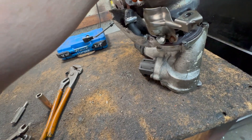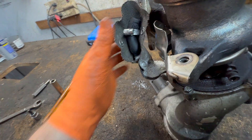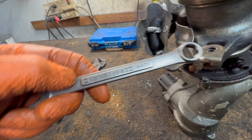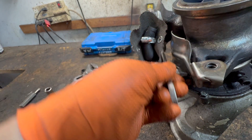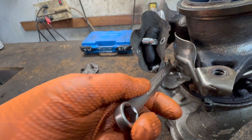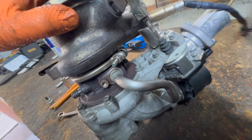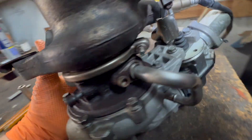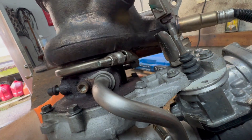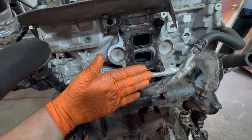Let me put it up so you can get a better idea. This is one that's not so bad to get. That one — you're going to have to put a 12 millimeter box head in there first and crack it loose. Then you can use the open end side a little bit to get it out. It's very tight, because you think you can go through this way, but there's nowhere to get to it. They give you a little bit of room underneath there, and you're going to be working like this to get it off.